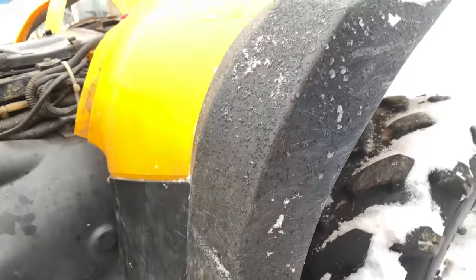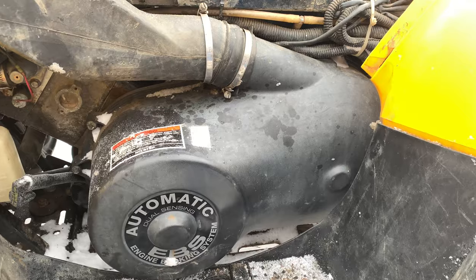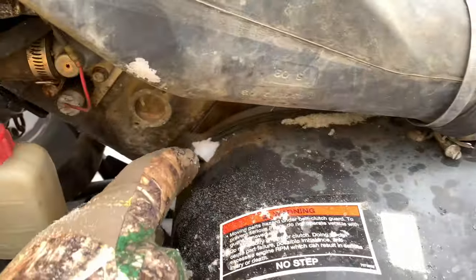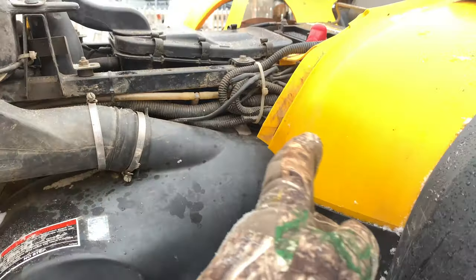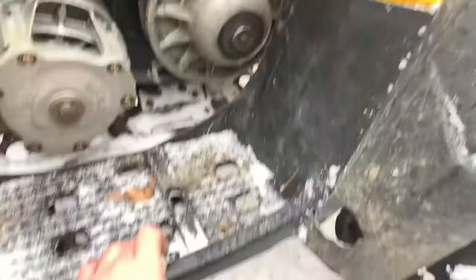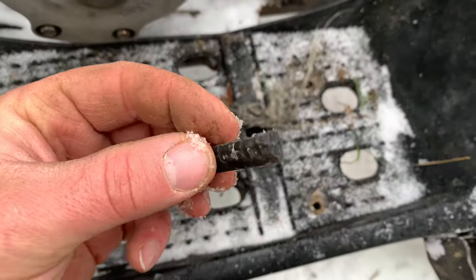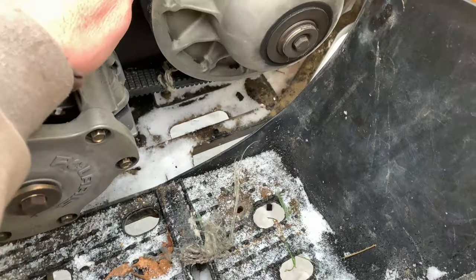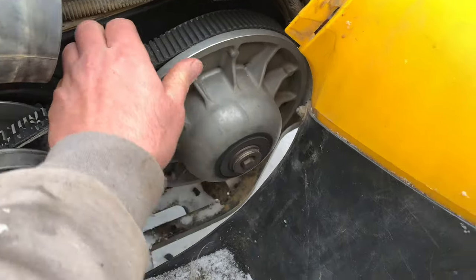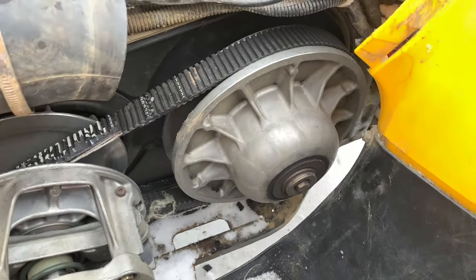I've got these fender flares on, so I'm going to try to just pull this out enough to slip it out of there. It's better to have more room, but it's probably about 20 degrees out. Then we're going to start taking all these 10 millimeter bolts and slip that cover off. We were able to wiggle that cover off — it's probably best to fully remove it because it's prone to crack, but we didn't crack it. There are fragments of the belt. We're just going to take this off like a bicycle chain, start going off the sprocket, and put the new one on.